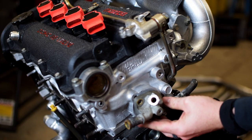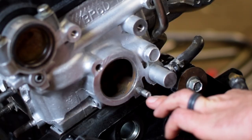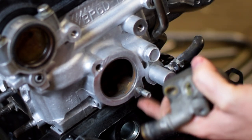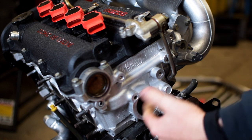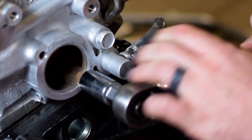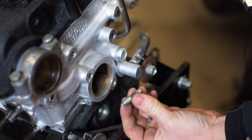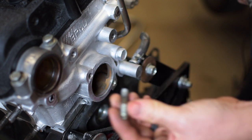This is the neck that you'll remove right off the bat — this is the factory setup. 12 millimeter bolts, take this out, and you're left with this little stud here, which is the same on the front of the engine. We can't use that because of the length of the reroute, so we're going to take that out. If you don't have one of these stud pullers, you're going to want to use just two nuts, tighten them together, and then back it out. Once you take it out, you won't need this stud again — it's also the same as your intake manifold stud if you're ever in need.